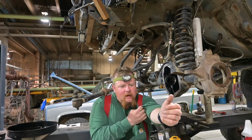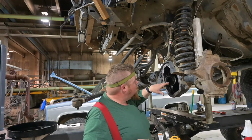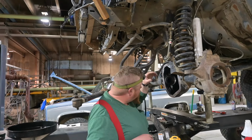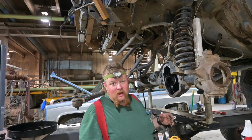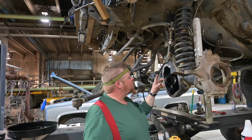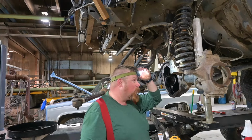So we're kind of getting everything set up here. Here's what I'm doing next. This copper air line runs inside around the differential, and to keep it up and away, because there's not much clearance in there between the teeth of the ring gear and the top of the case, I want to make sure that it doesn't bounce or move. Once that ring gear's teeth catches that copper line, it can rip it out. That happened to me once before. This failure this time was not that. What I'm gonna do is drill a hole or two in the case and tap it and put little brackets in there. That way, once it's all up in there, it can be held.